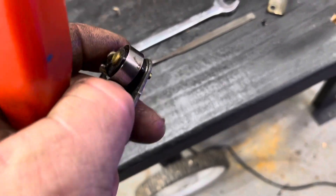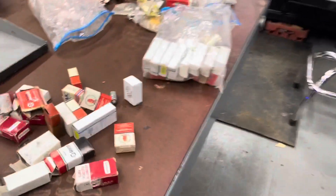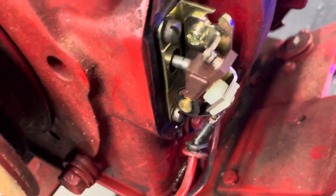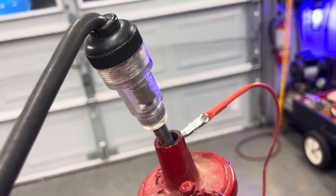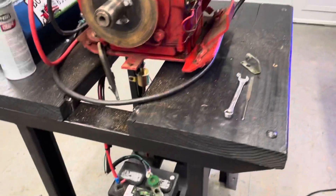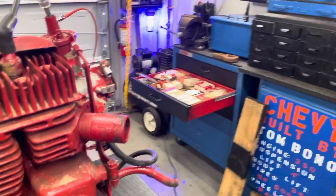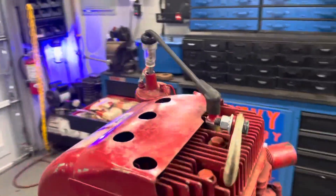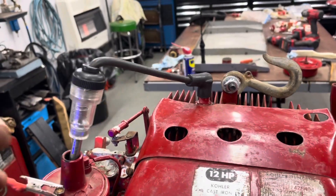I said, oh man, we're going to get some points. So I dug through pop's points that he had down at the shop, found a brand new set — not OEM, but close enough. And now I got a spark. So next step is going to be getting some gas in the gas tank, see if my electric fuel pump works. I don't have a muffler so it's going to be pretty loud, and I don't have a coil wire but I'll see if I can hunt something up — that'll work even that way.